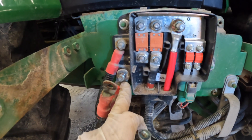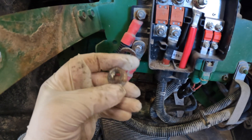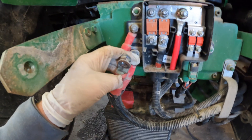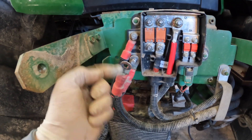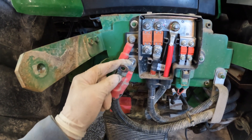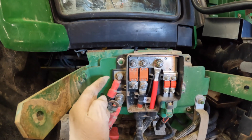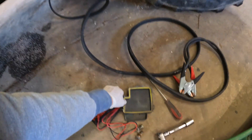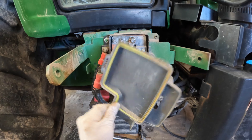The second nut — which is behind the starter cable — I did go verify: yes, this is the starter cable. This is the cable coming directly off the battery. That nut is clean, everything is clean behind there. So it's just the face of this nut which was back behind here, so it just wasn't making good contact is my guess. Let me go clean this nut up, brush this cable off, and we should be good to go. Everything inside the box is clean — it's a sealed box with a nice gasket going around it, no issues inside.